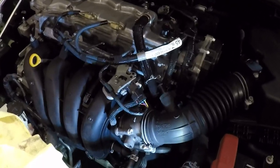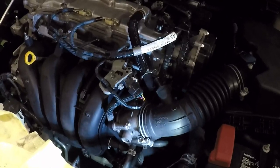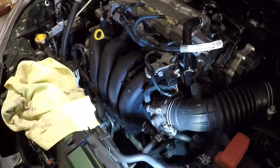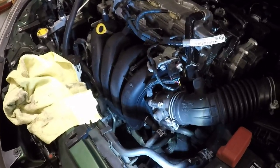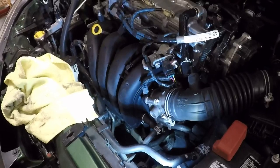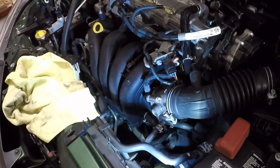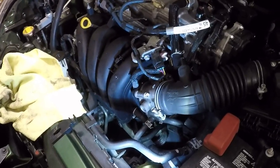Like I said, when I talked to that mechanic from Toyota, he said this is becoming a maintenance item. If it idles rough, you're probably going to have to do this to smooth it out again. They seem to idle a little rough here and there, and as they get more gummed up it'll just get continuously worse. But just keep an eye on it — if you have to take it off to clean it, it's a very easy process. Just take your time, you only need a couple of basic hand tools, and just be very gentle with the throttle body itself when you're cleaning it. I hope this video helps a lot of people out — thanks for watching.